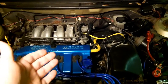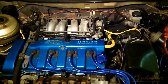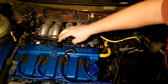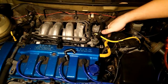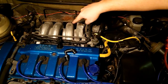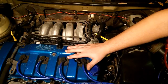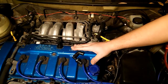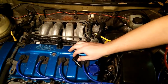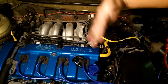It's really easy to check your PCV valve and breather hose — literally takes one minute. As a preventative maintenance item, check your PCV system. To summarize: your PCV valve sends blow-by gases back into the intake manifold, and the breather hose sends crankcase gases back into the intake manifold as well — two locations for the PCV system. I'm only familiar with the 626, FS engine, and KL engine. Every system is unique, but the principle is the same for just about any engine, because after the 1960s it was mandated that you had to have some type of PCV system and not vent blow-by gases into the atmosphere.